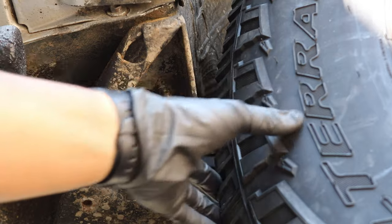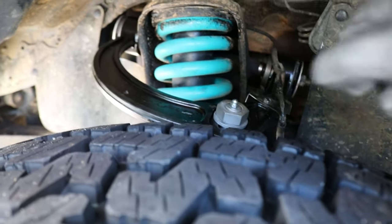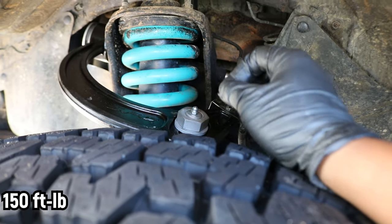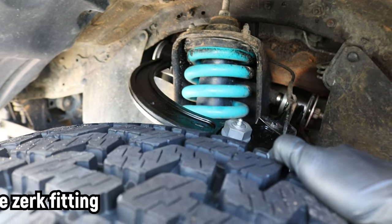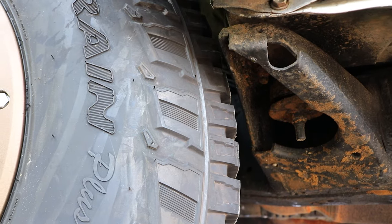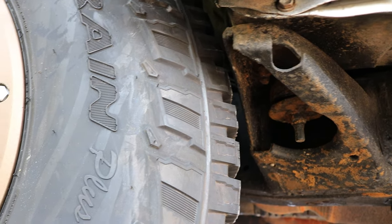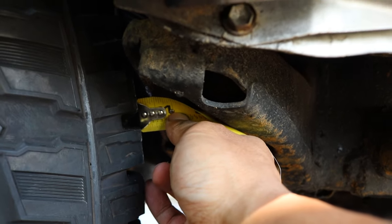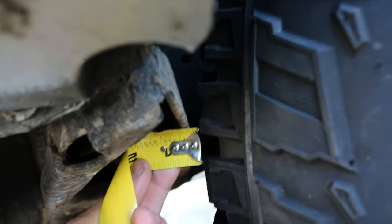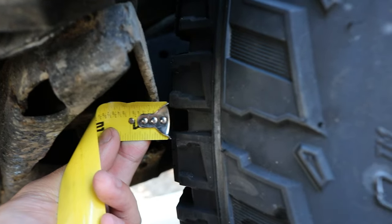The truck's back on the ground. I'm about to start doing the rough alignment. I just want to point out that this nut here for adjusting the camber has to be torqued down 150 foot-pounds if you are going to do the alignment yourself. I do have a DIY alignment video on how you can do that in your own garage — I'll link that in the description below. Alright, as you can see this is flat ground, and the clearance right there is probably about a quarter of an inch. Full lock. Passenger side clearance is just about the same — quarter inch, full lock. So that's still pretty good.